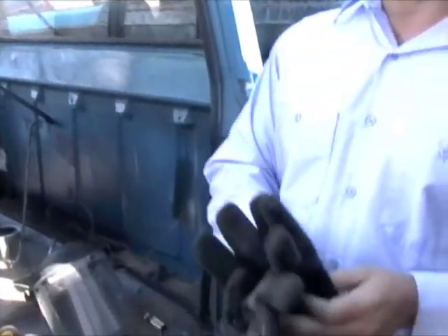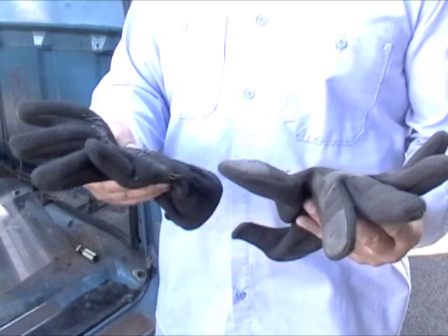You also want to use leather gloves — preferably heavy leather, though sometimes there's a problem handling the tool with those, so I'm using these mechanic gloves. With the sparks, you also want to have a fire extinguisher nearby. We have a mini extinguisher here, which works very well.